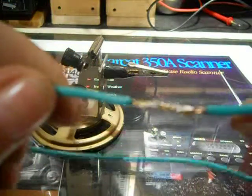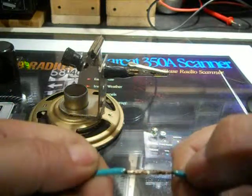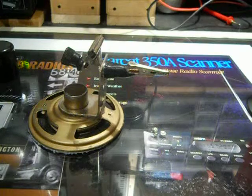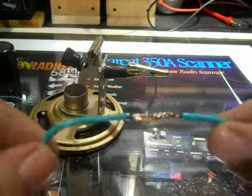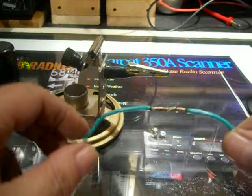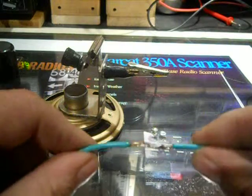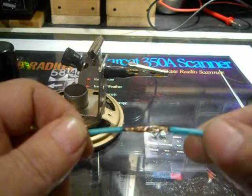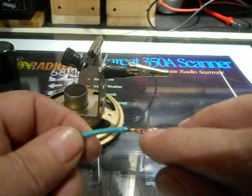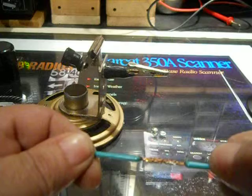Now we are going to do the test. This never is the prettiest thing. We've got a hold of this pretty good — you can see me flexing. Really pulling that apart — I can't pull that apart, there is no way. That is the proper way to solder two wires together. You put heat shrink tubing, or if you don't have it, put plenty of electrical tape. The military way is to wrap all the way across, wrap back again, then go back to the middle and put extra in the middle — so if it starts unraveling, it unravels at the middle first and you've already covered it twice.